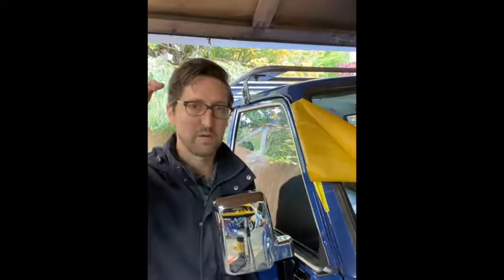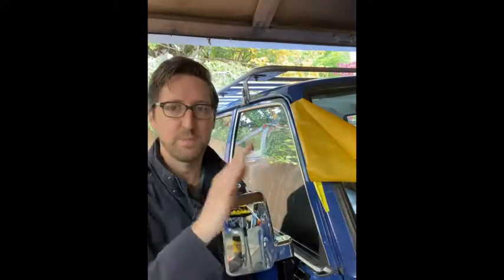What that's basically creating is the tape is kind of like this. Here's the surface of the paint, here's the tape. And so now you have this kind of curved area. When you're painting, all that paint's hitting that curved seam, and it causes a gradation of paint to go into the cavity. So less and less paint is making it into that curved area, and you get a soft, faded paint edge, not a hard edge like I mistakenly did.